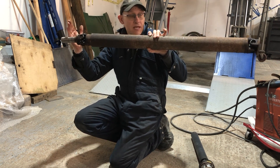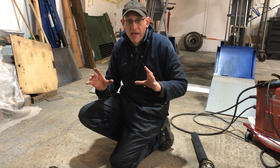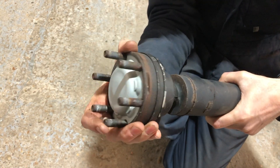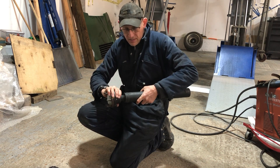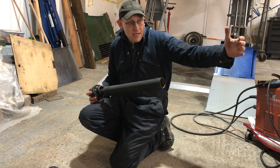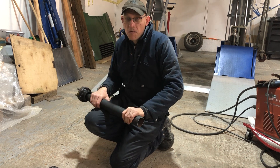We need to actually make it slightly longer — about this sort of length — and put a flange on this end to pick up on the end of the gearbox. We've got about a six-degree included angle on the prop shaft, so the universal joint will not be able to run through that angle without giving us some level of vibration. So if we want to make the car smooth, we need to move to a different kind of joint — and that's this. This is a CV joint, a constant velocity joint. This comes out of a BMW, I think. I want this piece in here, so I'm going to cut that out and put a new CV joint on it with this spline. We've got compliance in the sliding joint here, so we don't need another sliding joint in the system. The other end will join onto the tube and then a universal joint at the far end, which goes onto the differential. The front end will go straight onto the end of the gearbox, so hopefully we won't get any nasty vibration from the prop shaft.